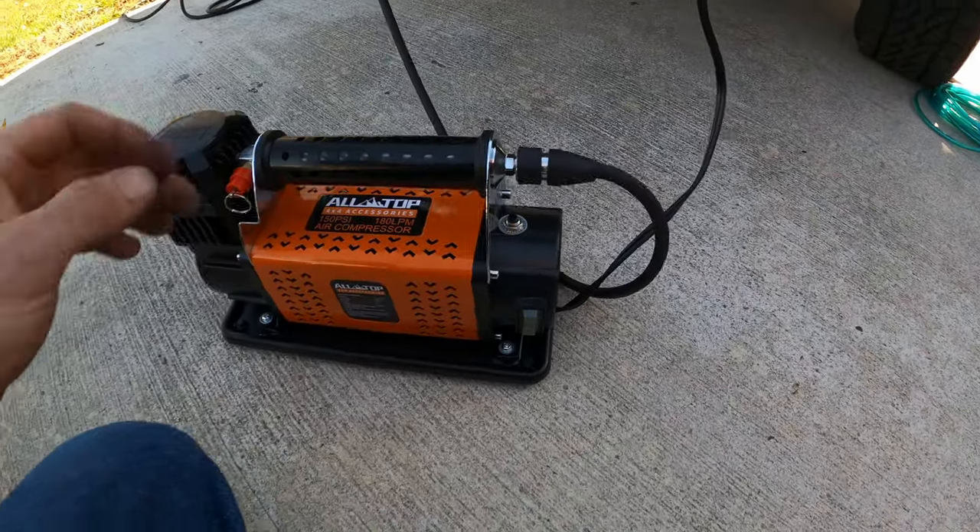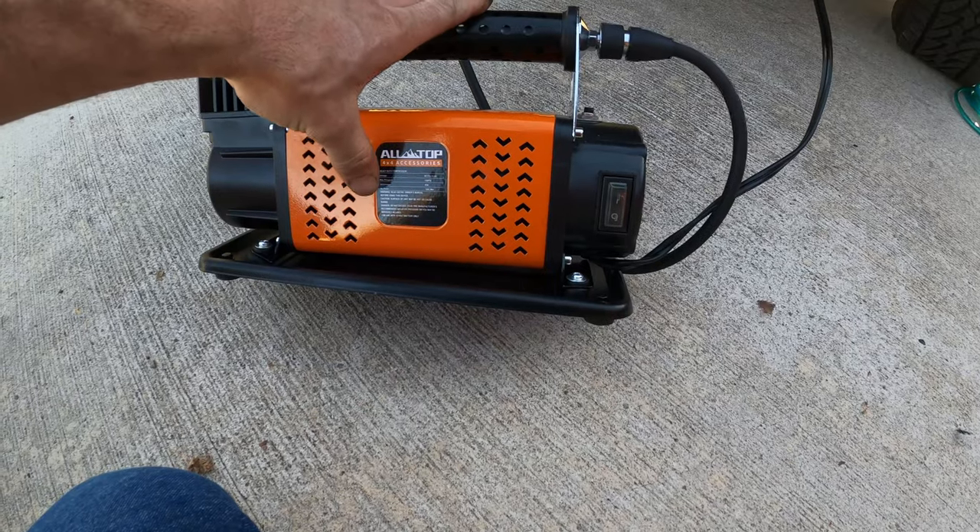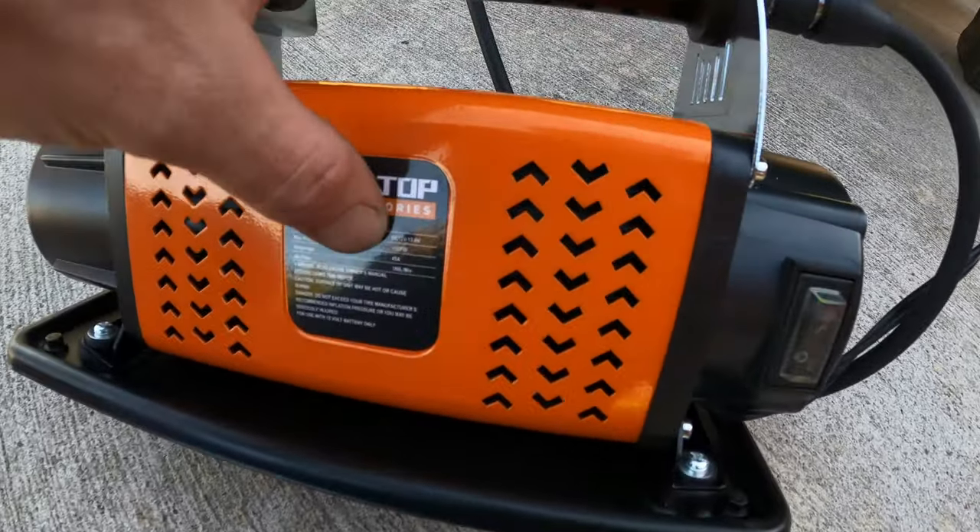They both have around the same 40–45% duty cycle at 40 PSI, and the All-Top draws 45 amps, so I'll give it a thumbs up — it works well. Check out those links below if you want to see these compressors. This design is very similar to the Smittybilt and many other Chinese no-name compressors — it seems to be a proven design. It's unfortunate that mine arrived with damage, so I'll reach out to the company. Drop a thumbs up or comment if this helped — KZ Guy 2, Chris Brown, see you next time.